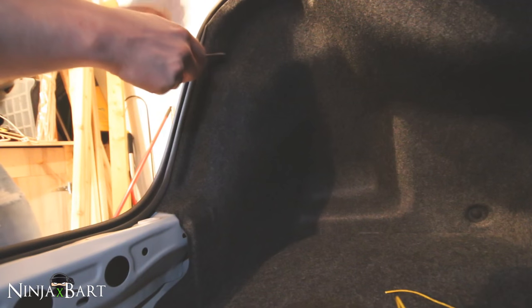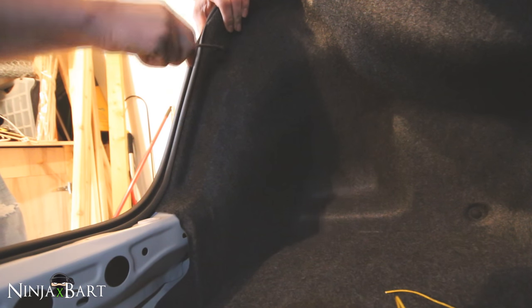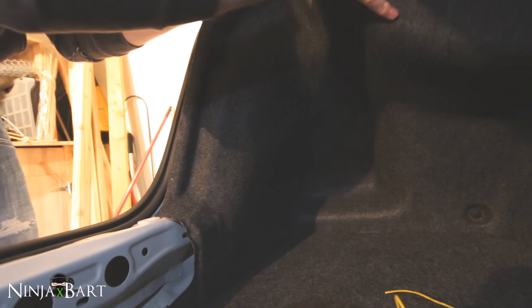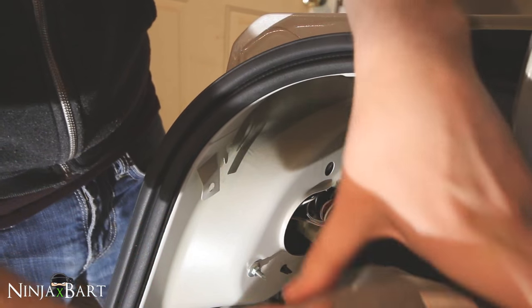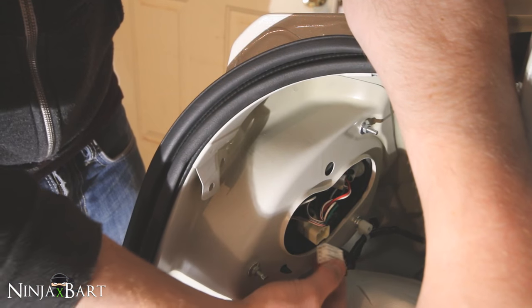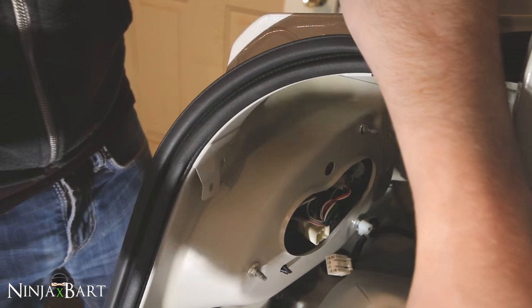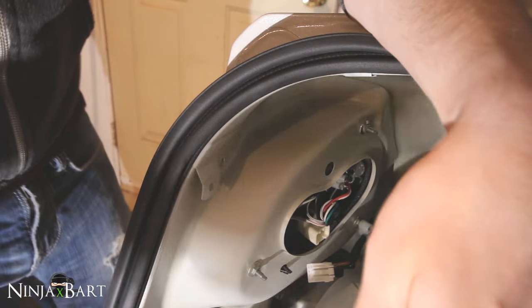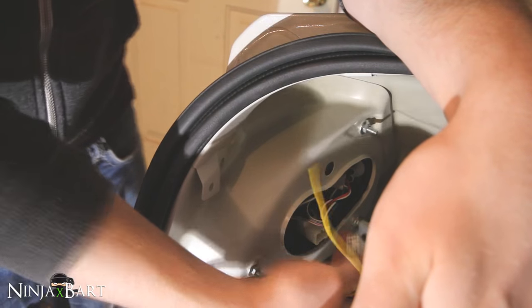Now what we're going to do is connect this to the power of the brake light. There are a couple of clips here on the inner liner of the trunk that you have to take out to be able to get access to it. We can gain access to where the brake light is by just pulling this back a bit. I've already unplugged the harness here, but you can see right here it just connects. I've cut a little bit of space here on this harness so you can see some exposed wiring, and now I'm going to connect these wires over here to the wiring going into the harness.